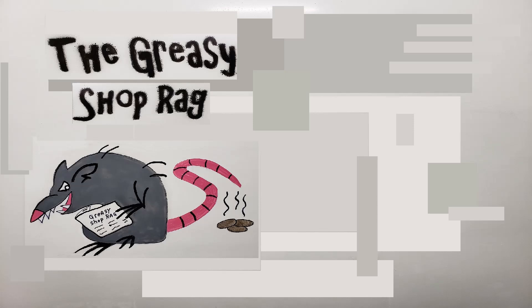We're going to start in the tank — and this is going to be one of those 'do as I say and not as I do' deals. The filter would be dirty and the hose would have a hole in it. I pull this out, look at the filter — it looks pretty clean — and the hose feels soft and supple, not old and hard. But I really should have pressure tested it. I already have it in my head that the problem's in the carburetor, so I'll just come back to this if I'm wrong.